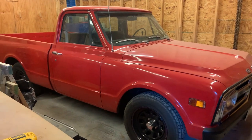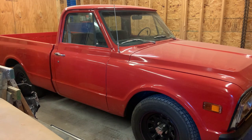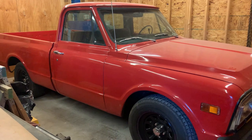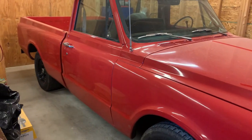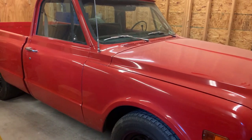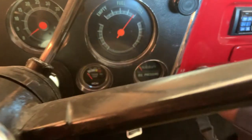This thing has been leaking transmission fluid out of the bell housing for probably the better part of three years. I pulled the transmission out and did the torque converter seal maybe a year, year and a half ago — that didn't fix it. So I bought the whole kit to reseal the pump, and I'm ashamed of how dirty this thing got sitting in here. I've got degreaser and parts, going to put it up on the lift and see if I can fix this leak.